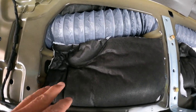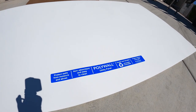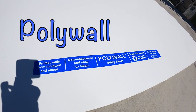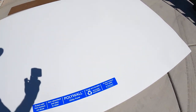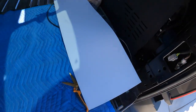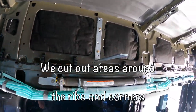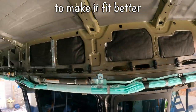Next we're going to put on the back walls to our cabinets. Here's what we're gonna use — it's a poly wall, really easy to clean and moisture resistant. We're gonna cut this into 12-inch strips, then use some gorilla glue to glue magnets on the back of it, and use that to attach it up to the wall.